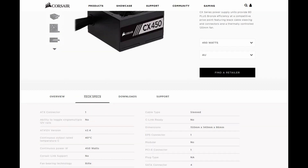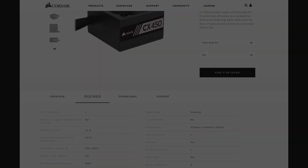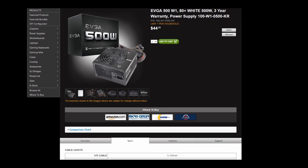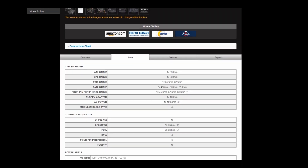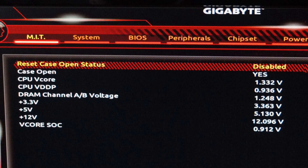Something that's quite important and often gets overlooked: look at the fan bearing in the specifications. I think they've upgraded the Corsair CX to a rifle bearing, but the EVGA one uses a sleeve bearing, and I have no time for sleeve bearings because they just don't last in my experience — even for a case fan, the bearings just wear out. I had fan failures on the CX ones, but perhaps with a rifle bearing that would improve things.